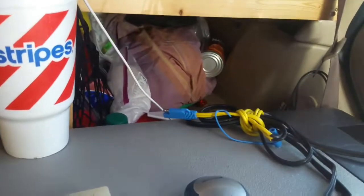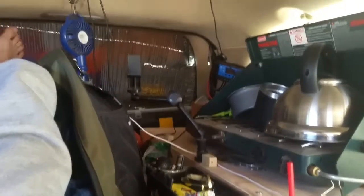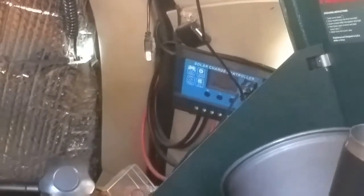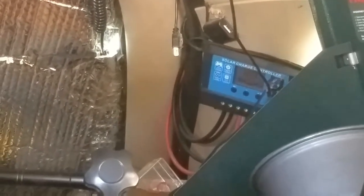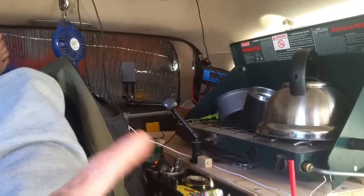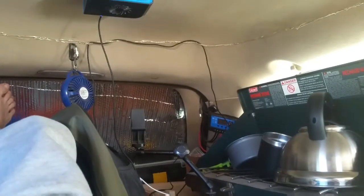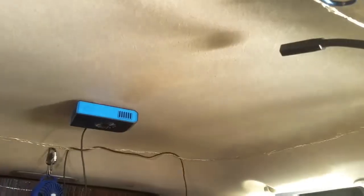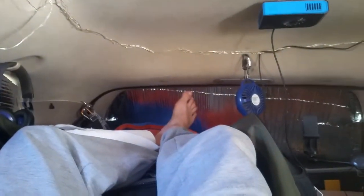I also want to make little shelves for canned goods and start putting my battery bank down there for my solar panel. I need to switch my solar panel battery — currently a cold cranking amp battery — and tie it into my main car battery. I have an AGM battery on order for my solar kit. I also want to build a hanging shelf from the roof section where the light is, for pots and pans.